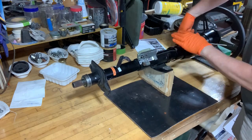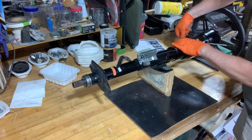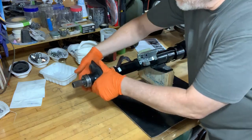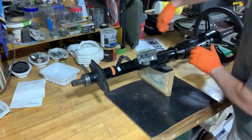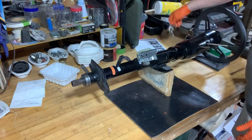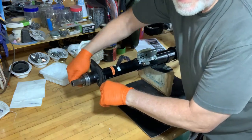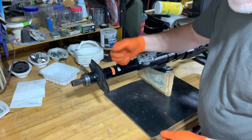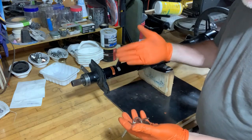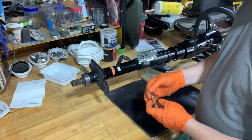You can turn the engine off, but you won't be able to put the key in the lock position and you won't be able to get the key out. So what the deal is, it forces you to put the car in reverse, that lever comes up, you turn the car off, this locks, you can pull the key out. Now without the key, this won't turn, of course, and neither will this. So now the car, by that cable, is locked in reverse. It's supposed to be an effort for anti-theft, and it might have worked some of the time.